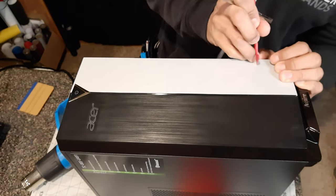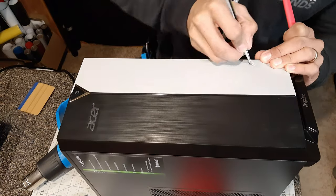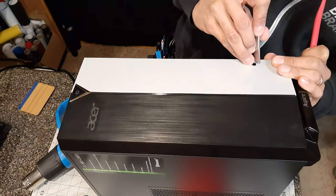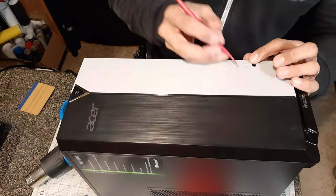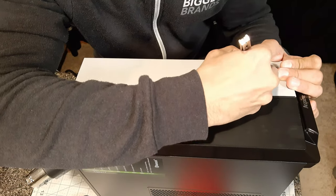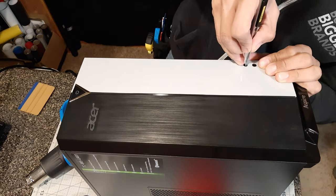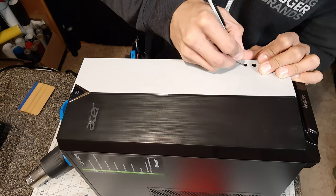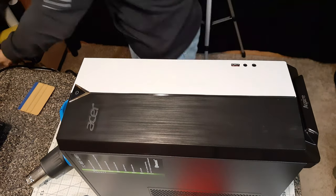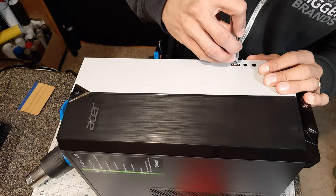Using a little heat and my micro squeegee to define the edges and lines of the microphone jack, headphone jack, USB ports, and USB-C ports. This is actually the most time-consuming part of this particular project — cutting out all the small little ports and in this case the Acer badge. You saw how fast it was to lay down the vinyl and trim off the edges, but right now I've significantly slowed down. Do take your time and be careful — you don't want to damage any electronic pieces. Use heat to help define the edges of each port.